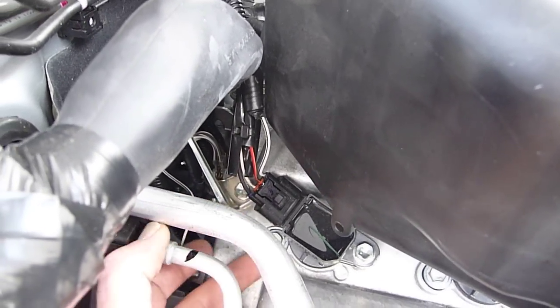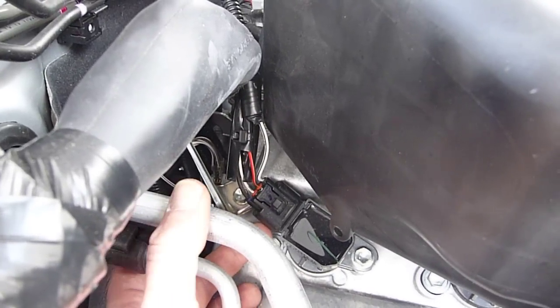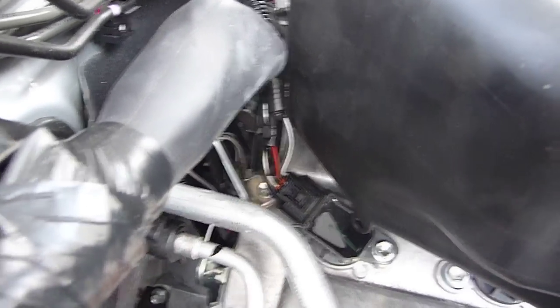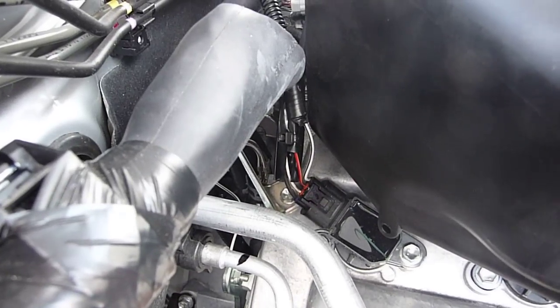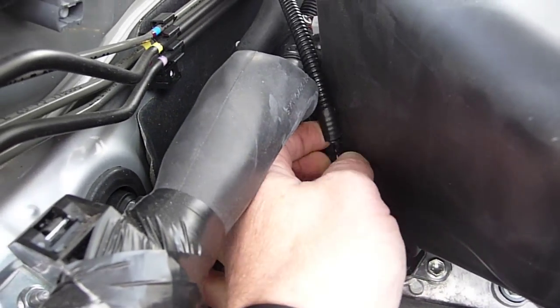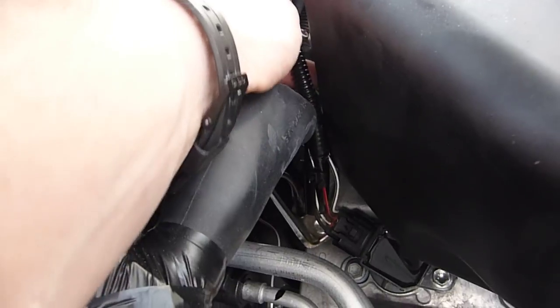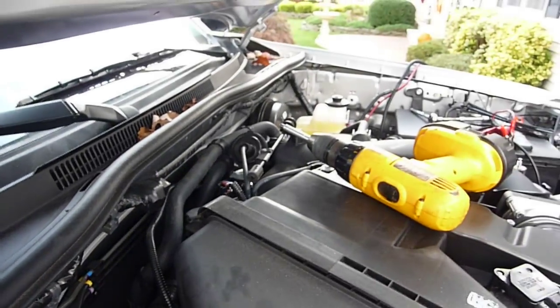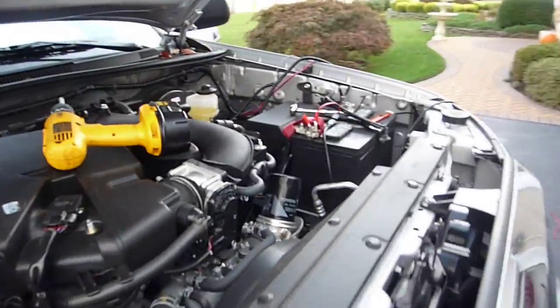The one that's the odd man out on each one of these injectors — that's the one that's going to give you your TAC signal. So any one of those is viable. You go to any injector, it doesn't really matter, but since this engine's so tight, that's the one I chose to use. Once you make your connection, get it in, tie it on, grab yourself some wire loom just like the factory uses, do it nice and neat. Put a wire tie on it, make it nice and tight. I'm going to run that across the engine compartment and show you what I did on the other side.